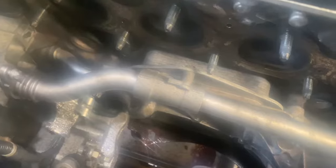Now I've actually fitted all the seals to all the pipes, including the cooling pipes. Just always remember when you're removing the oil filter housing including the cooler, to replace all the seals - not just the ones on the cooler itself, but all the oil filter housing seals, also on the pipes that go to the power steering pump and to the oil channels. There's also a seal for that one and one for this one - always remember to replace them.